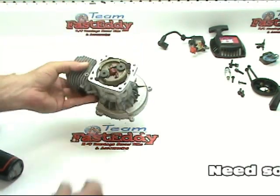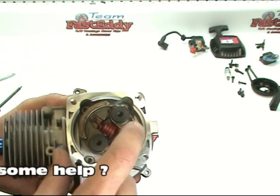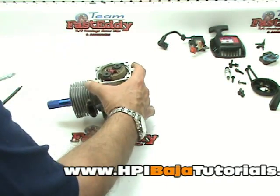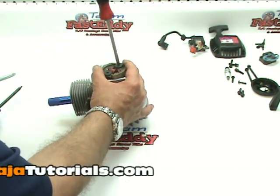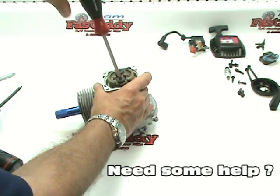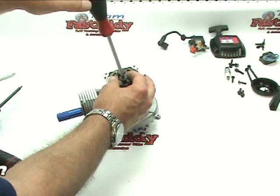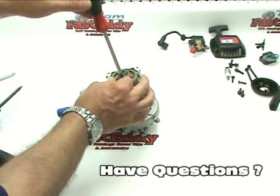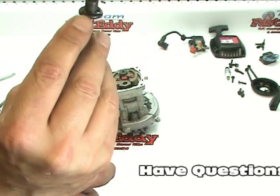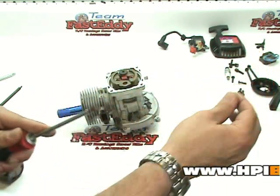Let's go ahead and remove the clutch from the clutch holder. Basically those are these two bolts right here — we're going to go ahead and remove those. Go ahead and turn it until your piston stop catches and that will help you get enough torque to take those off. They are a fairly large hex head — I believe they are five millimeter. As you take them off, watch out because there is going to be a very thin wafer washer on there and you're going to want to make sure that you don't lose those off of either of the bolts.